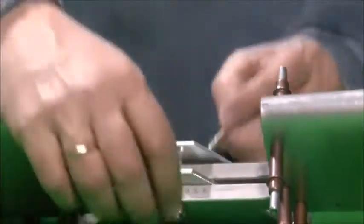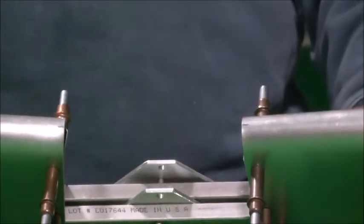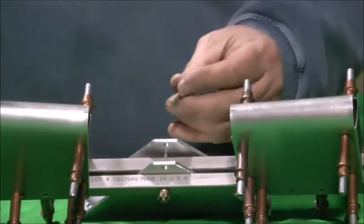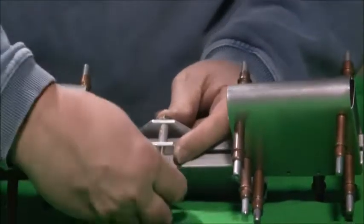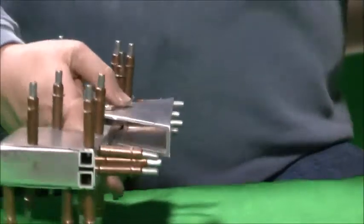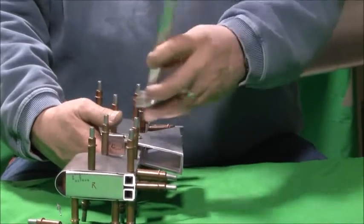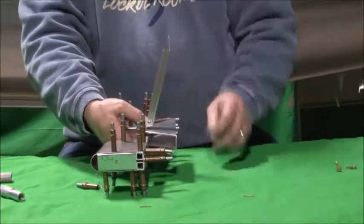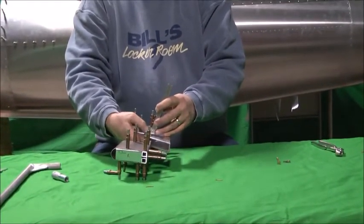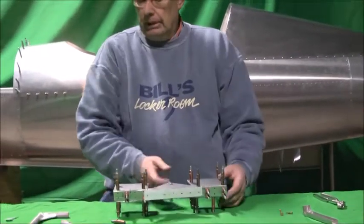Just to keep this rigid — to make this back into a box — we cut this out so you could slide this all through there and leave that little piece of tubing there. But to service this, to take anything loose, is a real pain — you'd have to take one pedal off and slide things out. So we decided to cut that off, put this little spacer through there with a bolt. This can just be a nylock nut because it's not going to pivot, and it gets tightened down. Once this goes into the aircraft against the firewall, this little bracket gets bolted on with two rivets up to the firewall, which makes it much more rigid. That'll be installed after we get everything riveted into the fuselage.